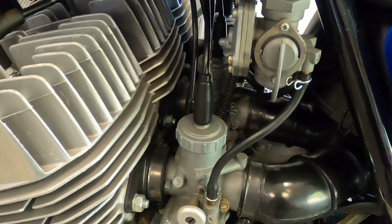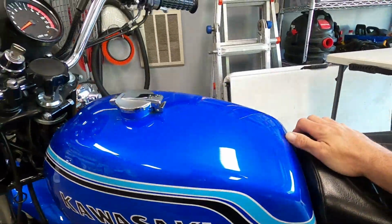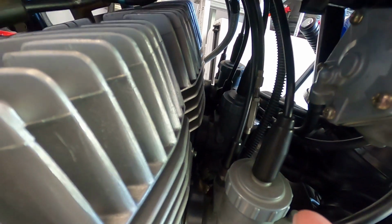But basically we're going to try to get to that middle carburetor for sure and figure out why the slide's sticking. Now when I take my throttle and twist it, I can actually feel on the side of the carb. It's hard to do this with one hand. But I can hear and feel the inside and outside when moving. That middle one's not moving at all.